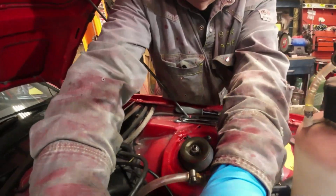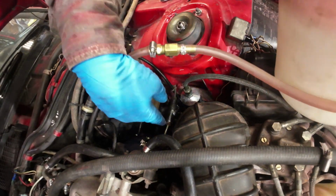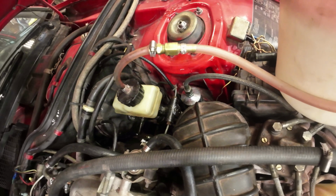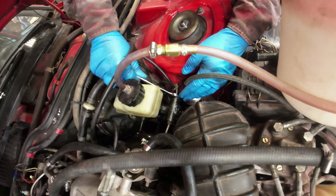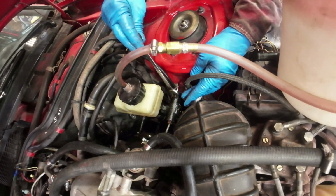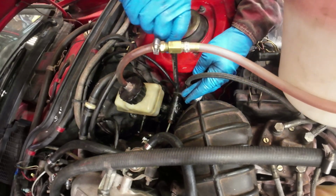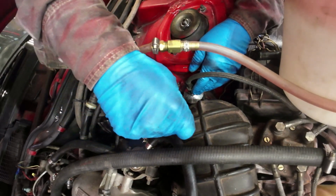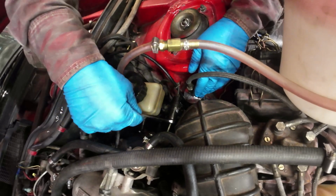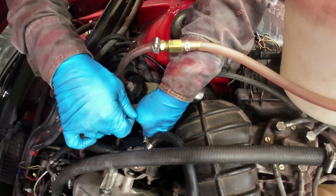Oh boy. Yeah, right down in there. If that camera will stay there without falling over. You looking at the right spot? Yeah, right there, hey? So I'll just bleed them off a little bit. I'll find an 11 millimeter. This one here first. That lets the air out of the master cylinder, right? And that seems to be the air out of that one. Air out of that one. It's a messy job. This one here, I can't really see it. But I'll hear it, I think.